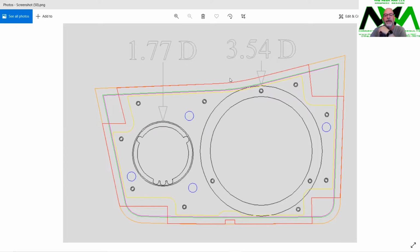Some other drivers that may fit are like JL C7s or Arc Audio RS3 and Tweet RS3, RS1. I don't have a full list yet because there are so many different speakers out there. But it's the kind of thing that if you know what driver you have, measure the outside diameter with calipers. Don't just say, oh, it's a 3.5.